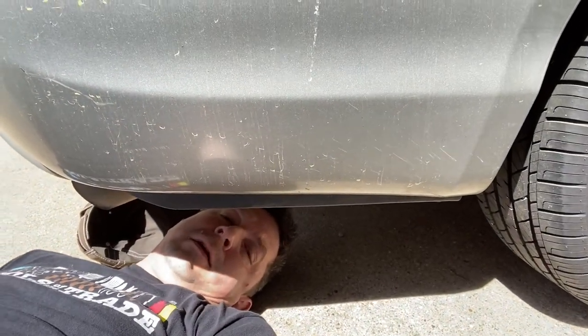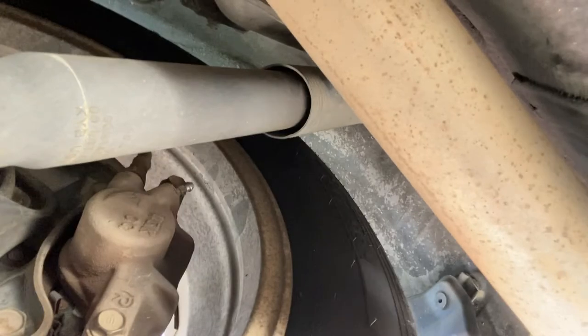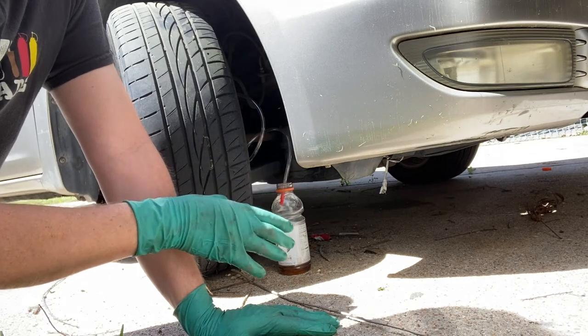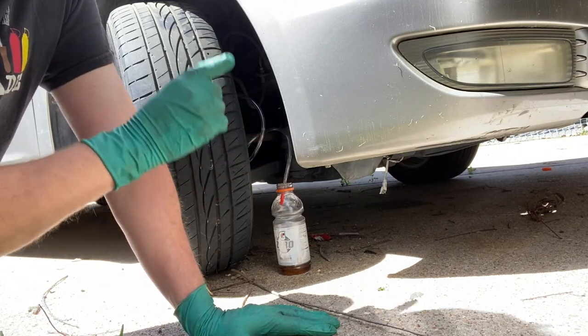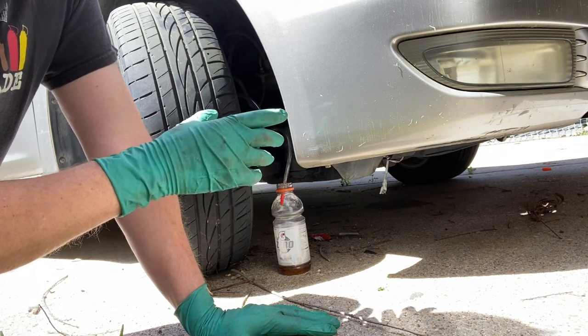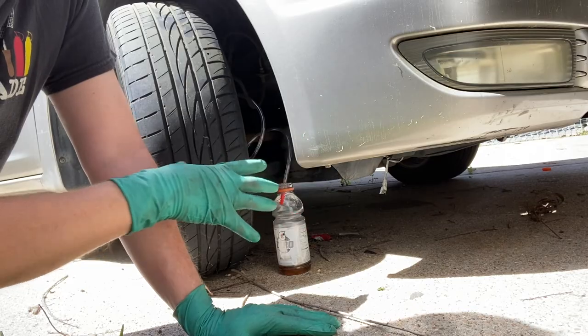For the rear of the vehicle, you don't really need to jack it up either — you can get underneath it like this. The caliper is on the rear side and the bleeder is accessible. This is the front right wheel; we're going to bleed it now since we've already bled the two rear wheels. Then we're going to finish it off with the front left wheel, which is the one we started with. After that, we will have bled all the air — or potential air — from the master cylinder all the way to all four wheels.